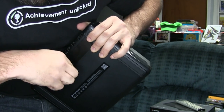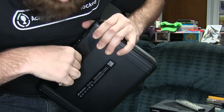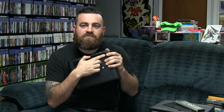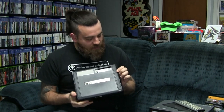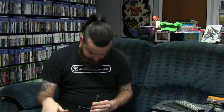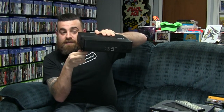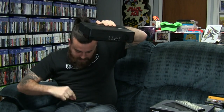Not gonna lie, that cover loosened a lot easier than I was led to believe. Anyhow, once you remove that, you will see the empty slot — and I realize now that's the screw they were all talking about. That's why you want a magnetic driver, because there's a lot of empty space in there for the screw to fall into, right into the case of your console. Let's see how tight that screw is... Oh yeah, that bad boy's not moving. Okay, I broke the tension. I'm going to unscrew it upside down — that way if it falls, which it did, it falls in my lap, not into the console. I'm a thinker.